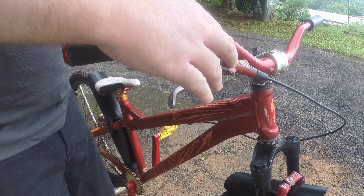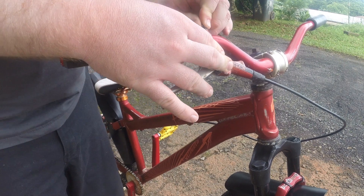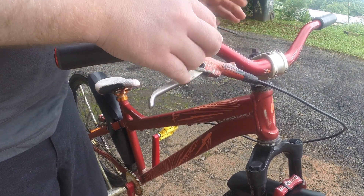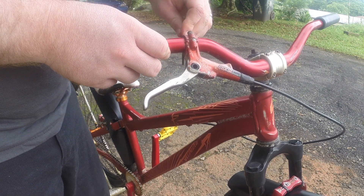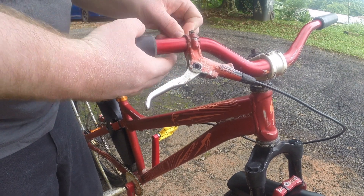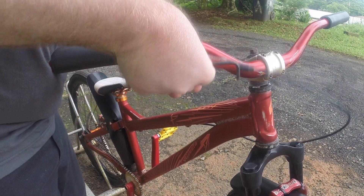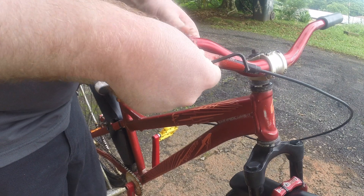Alright, then we're gonna move over to the bike. You've got your lever up front — what you want to do is loosen these bolts up. You're going to be moving the lever a couple of times during the bleeding process, so just loosen them to the point where you can move the lever fairly freely but it's still going to stay in place. If you live in a rusty state — I feel ya. There we go, that's pretty good right there, able to move it around.